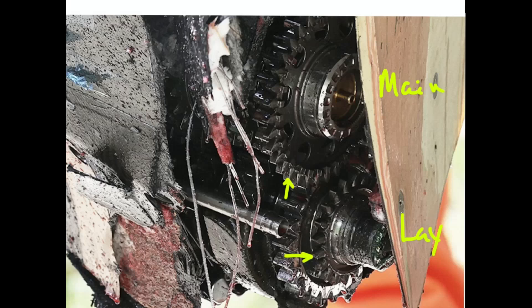This is probably the most significant picture of all three, from being able to show the actual details of the gearbox. This little piece here is going to feed oil down the main shaft itself, and there are oil holes in the main shaft that feed all of the roller bearings. This first gear that you actually see here on the hub is going to be your reverse gear. As you can see, the teeth are kind of angled, and that actually allows an almost Bendix-type drive to engage the reverse gear.